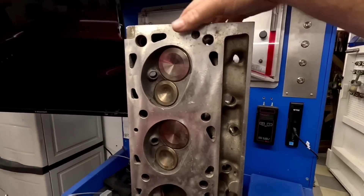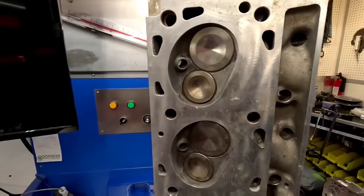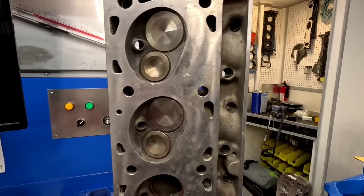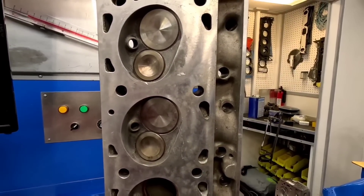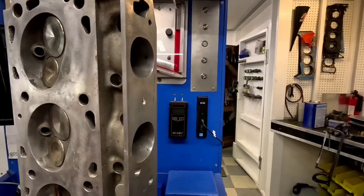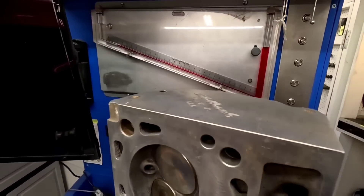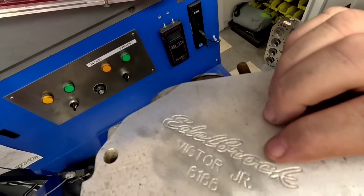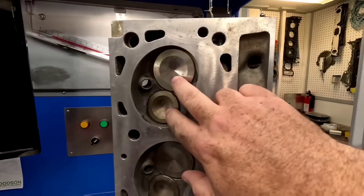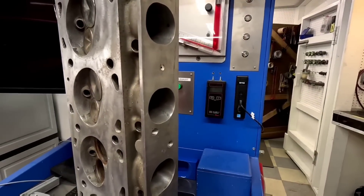What we're looking at here is a set of older Edelbrock Victor Jr. Big Block Ford 385 series cylinder heads. Yes, they look kind of ratty right now, but the question is what can we do to improve these cylinder heads without breaking the budget and without having a hundred hours worth of time invested in them. Just a quick glance — you see really big port volume. I haven't poured this cylinder head yet, but I think you can see that Victor Jr. 61-66, with typical valve sizes of 2.19 intake valves — nothing extravagant.